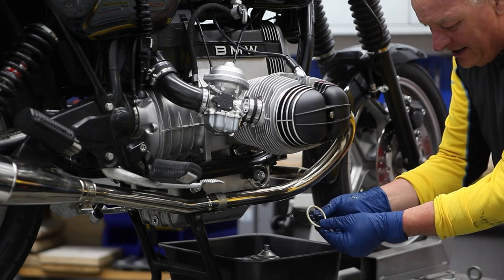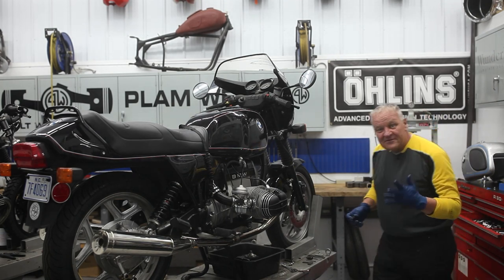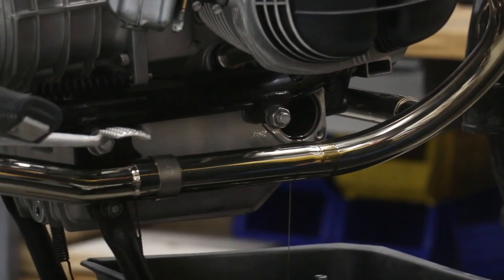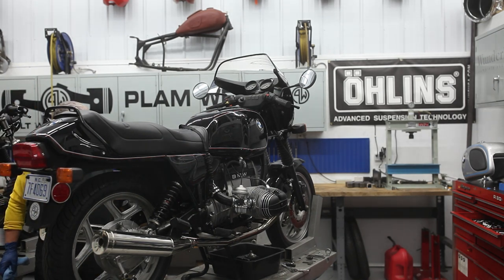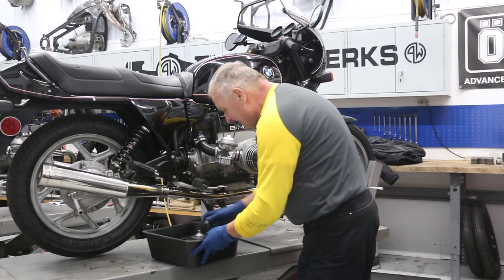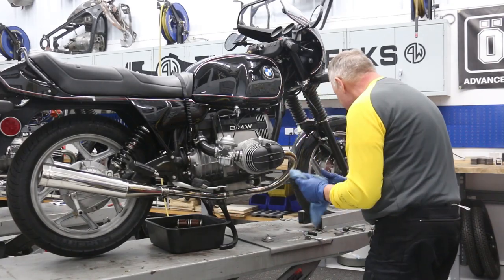What came out is an O-ring gasket and the shim — the kit will come with new ones so I'll replace all those. To get the filter out, a little hook tool works pretty good — just go in there and grab it and pull it out. Before I pull the drain plug out, I'm going to take the dipstick and unscrew it, let it hang there so it can vent out really well. Then relocate the pan and go ahead and get that plug out of there to get that break-in oil out.